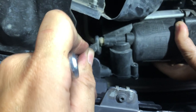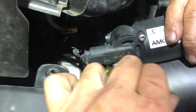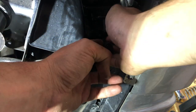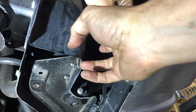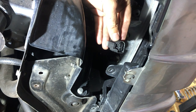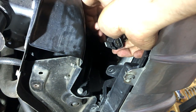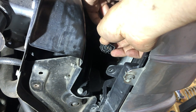Now that we've got those mounting bolts removed, let's get that pressurized airline off and the electrical connections off. On removal of the electrical connections I actually struggled a little bit with this connection here — we had to push back the white tab but it was still a little bit tight getting it off. You just need to make sure when you're removing this one that you've got that tab at the back pushed all the way back. The other connection, which was slightly higher, simply had the clip to press in like the traditional style.